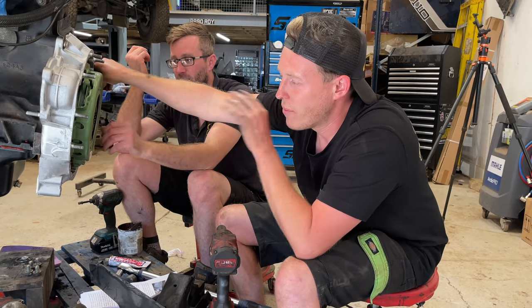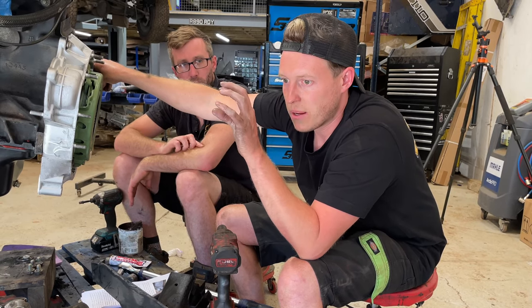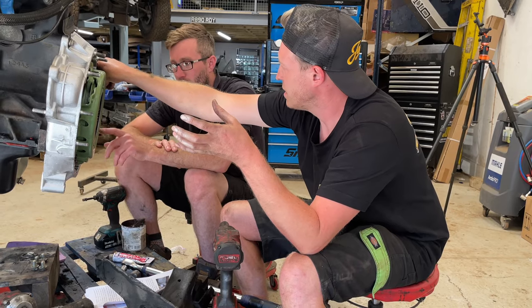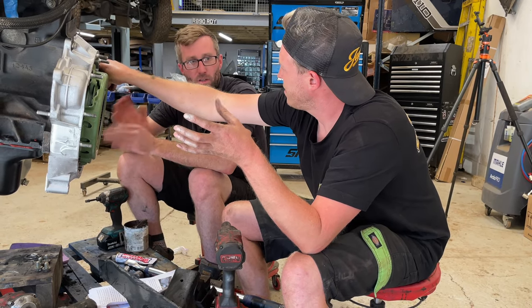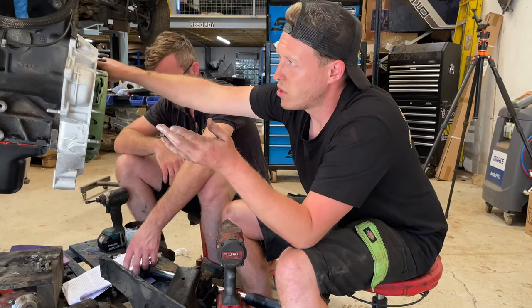So we've gone ahead and got a brand new OE cartridge, which is one of their, it's not a hybrid, but on the impeller they've CNC'd it differently. Yeah, and I think it's got more fins on it as well, so it spools up like 500 RPM sooner, so that'll be really nice. So tomorrow we're gonna strip down this.